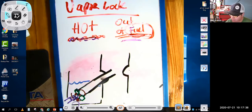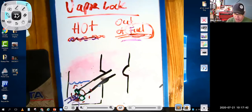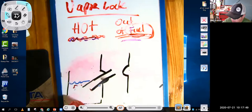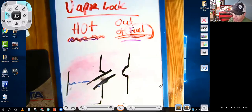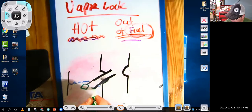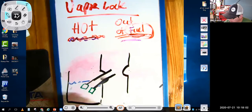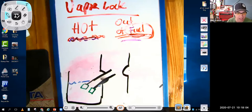In the small engine, it's the fuel turned to vapor right around the main metering jet. Okay. So by getting rid of the adjustable system where you had that screw that would go in and out of the jet, by just having a fixed jet in here, it prevented people from having a screw that they could turn that could make the engine run too lean or too rich and screw up the emissions or burn up the engine.